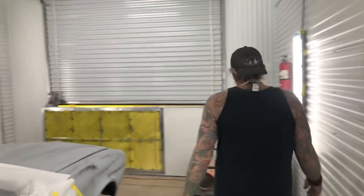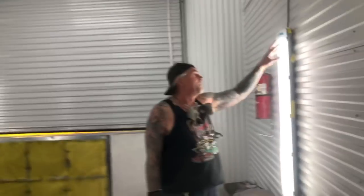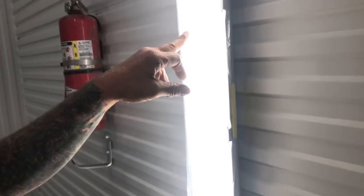We got a mistake up here. Minnie was supposed to tape all these lights off with cellophane, and the tape's already falling off. Not really happy about that. The reason I taped these, I wanna show everybody, we got LED lighting. These are explosion proof. They're weatherproof, everything proof. The only proof they're not is gathering up overspray. So I put cellophane on them to cover it, because we don't know when these things are going to be discontinued, and to get one of these covers costs $45.